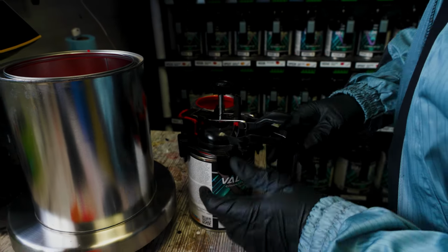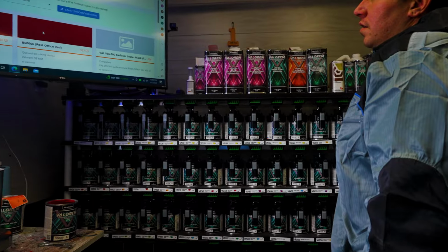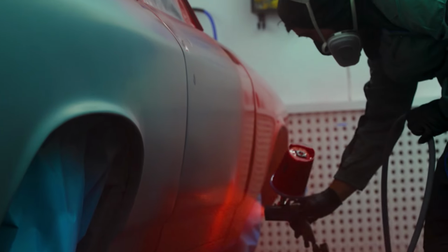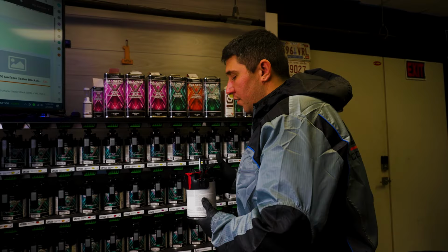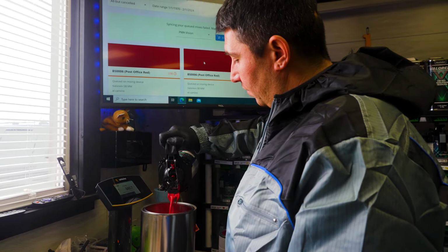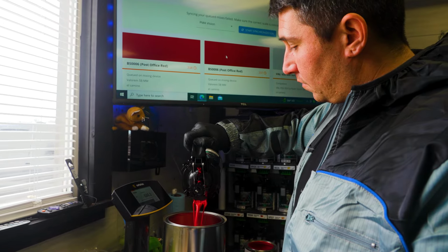So today we're gonna use the Exodus 1-3 OP for base. We're gonna use the Sun Pro light attachment, which comes in very handy for doing these rocker panels and stuff up underneath, especially with my limited mobility. It's sometimes hard for me to get down there and make sure I got coverage on the rockers.